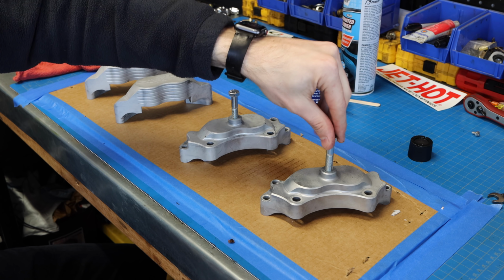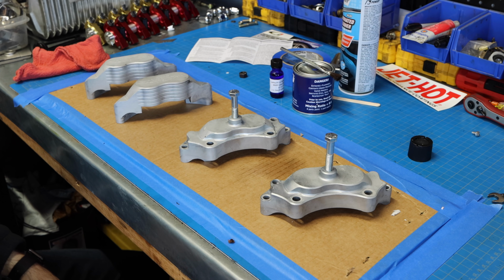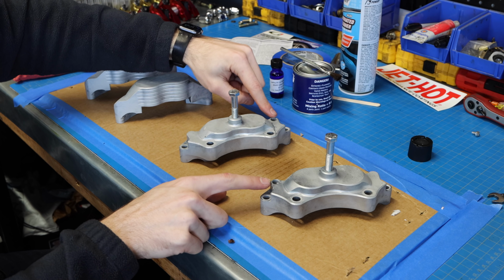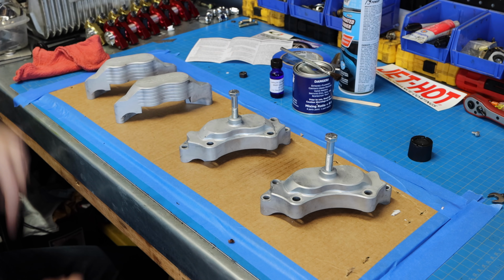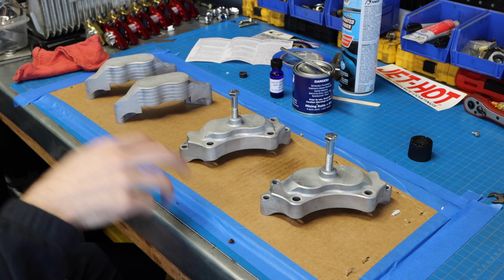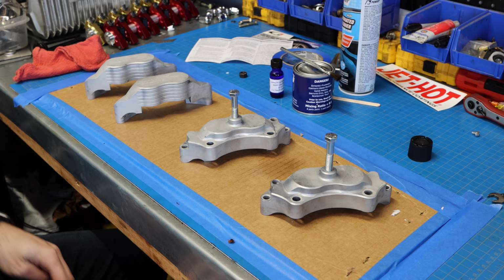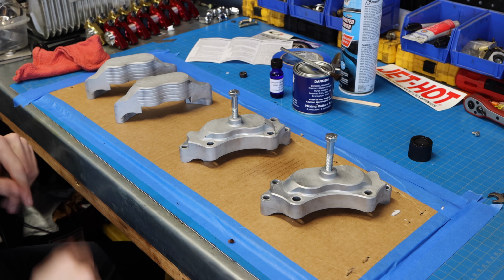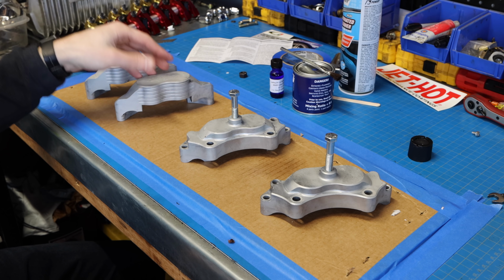You'll see that I've got some bolts in the feed lines for the brake fluid. These bolts just happen to thread up and work perfectly, so they're gonna plug those holes. There are also two bleed holes right here. These I don't have a screw that fits into, but those also need to be taken care of when you're painting all of this. You don't want paint to go down into the actual braking system. I am gonna test a few more bolts. I'm hoping that I might be able to find one. We'll see about that. But you can see they are pretty blasted and hazy.